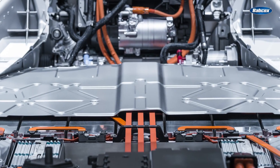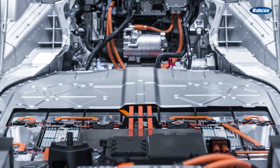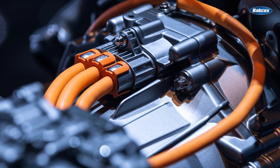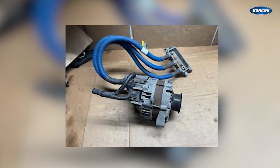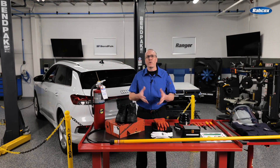Now let's talk about high voltage. One of the first things we all learned is that brightly colored cables indicate they are carrying high voltage. There will be multiple cables on any EV because in addition to the electric drive units, many EV systems utilize or distribute high voltage to a number of systems, including the air conditioning, coolant heaters, steering, power inverters, battery chargers, and high voltage distribution modules. It's important to remember that while orange is the most common color for high voltage cables, some manufacturers may use yellow or blue — but regardless, they are brightly colored so they jump out as a warning no matter where they are located on the vehicle.